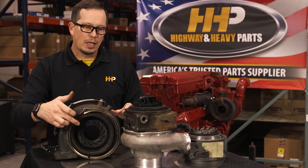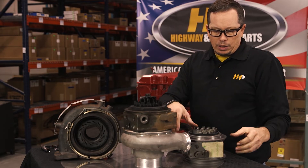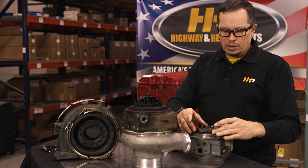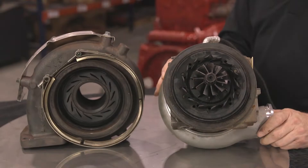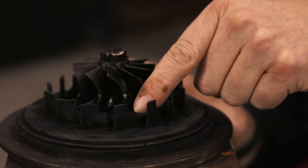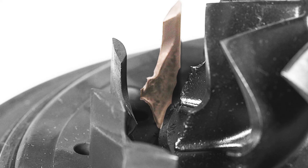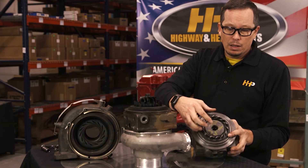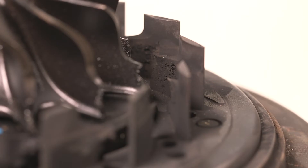What was happening is inside the exhaust housing, you've got this shroud plate, and the shroud plate is what the fins actually travel through. This shroud plate is actually inside the exhaust housing, and the fins travel through it. This particular one has had some damage to it. If your shroud plate is all the way in and you get a bent fin, that fin will not travel through that plate anymore — it'll hang up and give you problems.